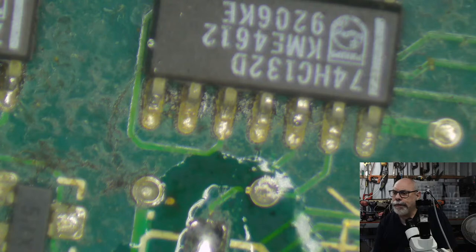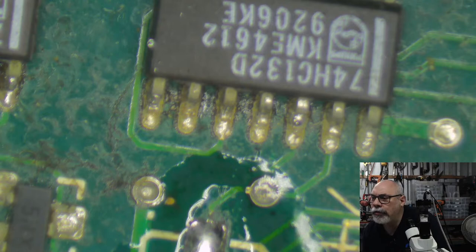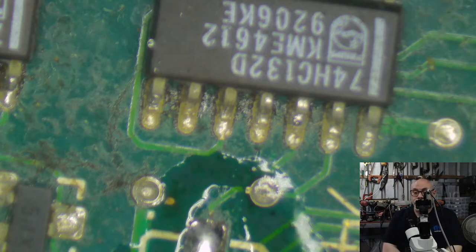Okay. I got an aqueous cleaner from Mouser, and last time you said you would use the ultrasonic with the solution followed by dipping the board in IPA to get a clean board. Yeah, so I left the residue on the board in my case. Okay, that's interesting. I definitely don't get residue on my board